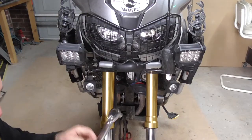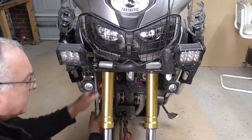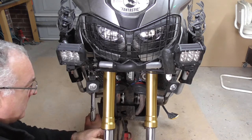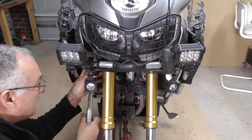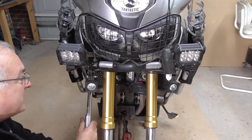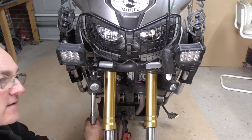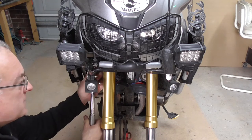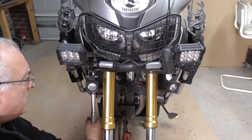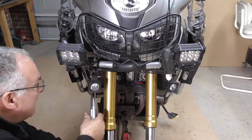Alright guys, so I set it 25, and then obviously I've gone up. I've set that one, you can hear it clicking. That means I'm at my limit. And then I tightened that one, clicking, got to my limit, went back to that one, and then it went some more. So there's a good pointer for you, just go backwards and forwards between the one and two until they're both at that proper torque setting that you require.